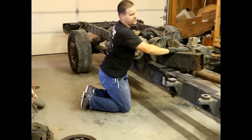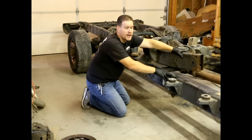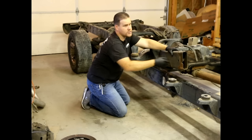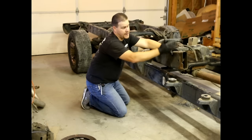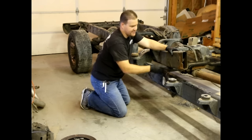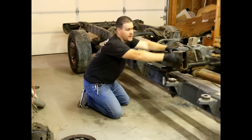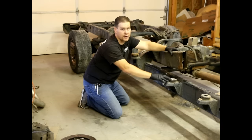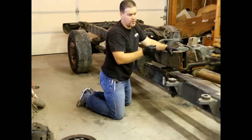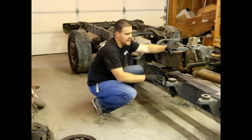The factory frame has been stretched and tapered down in the corners to slide in easier. We didn't have that ability, so there were two options: cut the four corners and bend it in, or just not worry about it. I just cut it off, slid it in, made sure all the measurements were the same, and welded it in. I did run into a couple of tight spots where a taper would have helped it slide in much easier. I had to use a come-along on each side to slowly inch it in to get it squared, but all in all it was a fairly straightforward process.